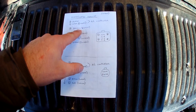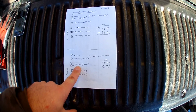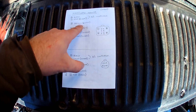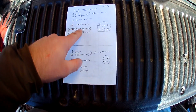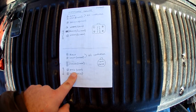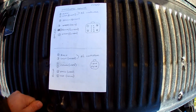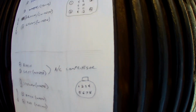This should be my starter wire. But the Ranger harness has two thick yellow whites. So I'm not sure if they both need to be mated to the yellow, white, blue or not. And then I have these three other colors in the Explorer harness, which only the black, white matches something in the Ranger harness. So this all just needs figured out. Take you around and show you.